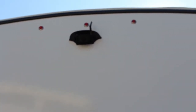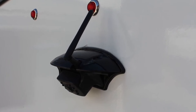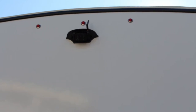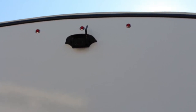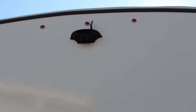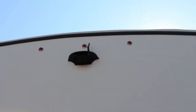This unit does come equipped with the backup camera installed. Even if you don't have one, most are coming prepped — you'll see an empty black box up on top, meaning it is pre-wired. All you have to do is remove the cover, plug in the camera, reinstall the cover, and pair the camera to the system — instructions are in the owner's manual. The most important thing is the power source comes off your running lights. You have to have your running lights on during travel for your backup camera to work — they don't kick on from the reverse light of the vehicle.